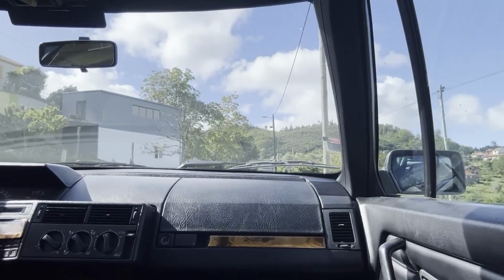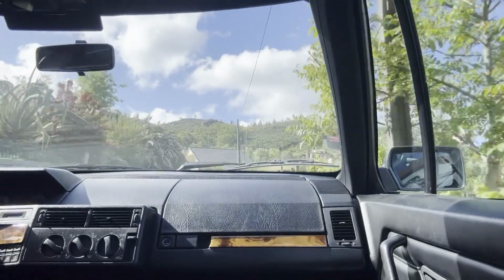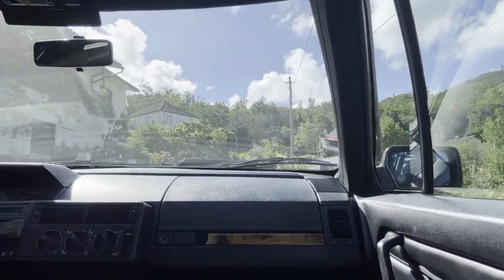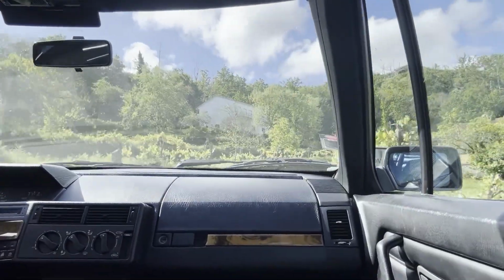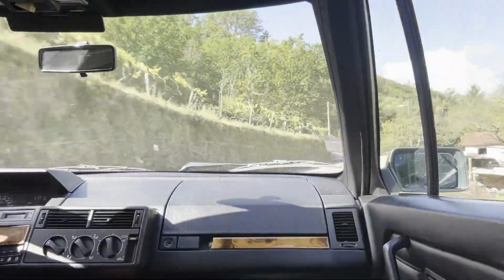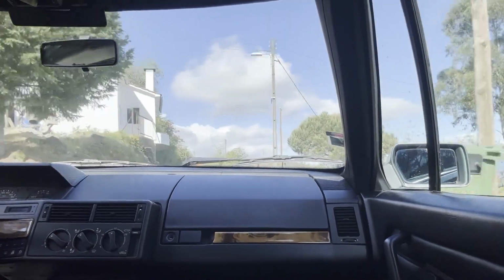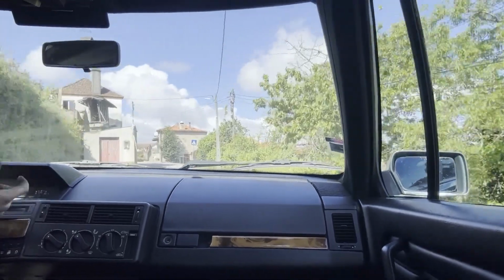Okay, we're gonna up the ante a little bit, because so far I don't see anything catastrophic in my work. I do feel the knock the moment I change the direction, I mean when I do this with the steering wheel, but after that initial knock, things are okay. Which does make sense, because after all, the issue shouldn't lie within the rack, and I've replaced the inner and outer tie rods. The issue is within the articulation between the steering wheel and the steering rack itself, so in the pivot in the column.